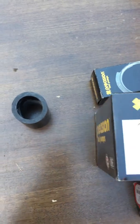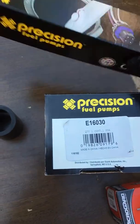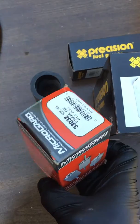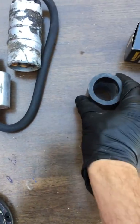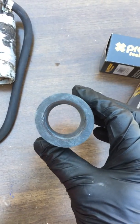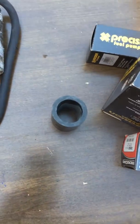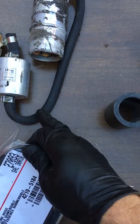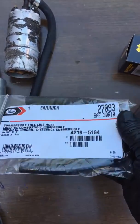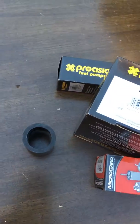What we need is a universal fuel pump — this one is from a 1985 Fiero — plus a fuel strainer and fuel filter. I'll put a list of the parts. You'll need a sleeve for the fuel pump that is submersible, meaning it can go in fuel without rotting. Additionally, the fuel tank lines have to be submersible as well; you can't use regular fuel line or it'll swell, rot, and burst.